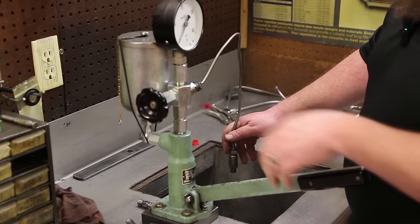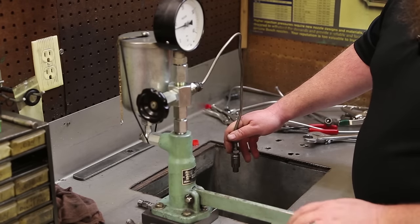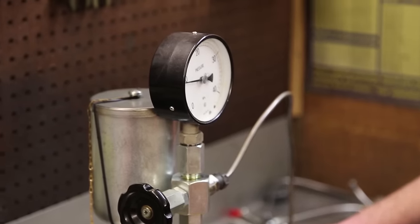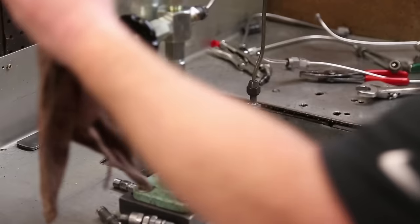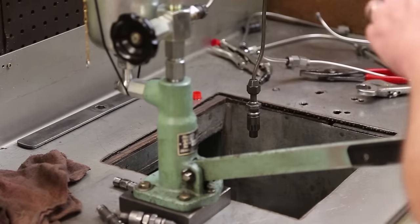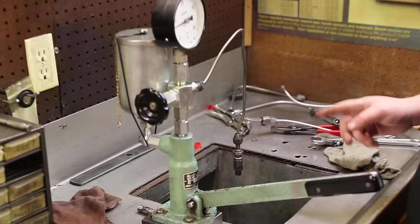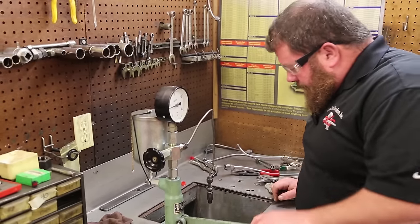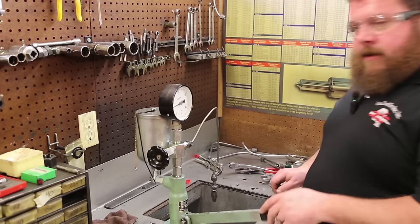We're going to open the valve. We're just short of 100 bar, which is spec. Given the circumstances, we're calling that good. We're going to give her the leak test here. Fantastic. She's dry. So, number one, the one that we thought we may have the most trouble with, looks great.